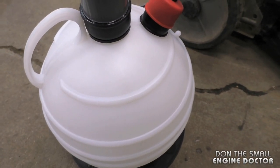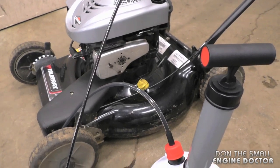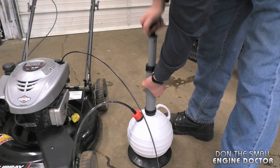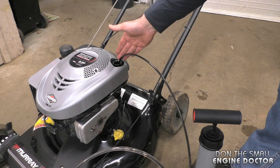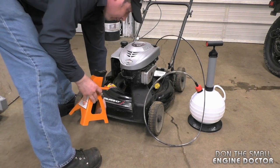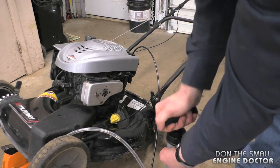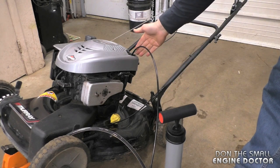You can hear the oil going into the container. Again, it's quite important to run the lawnmower for a few minutes before you do this, just so that the oil is warm and easier to extract. You can give it a few more pumps during the process. When you hear that noise, it's because you're just about done extracting all the oil from the engine. You can also lift the front of the mower — this will bring all the oil that's left totally to the back where the hose is. Give it a few more pumps and you should get a bit more oil out.